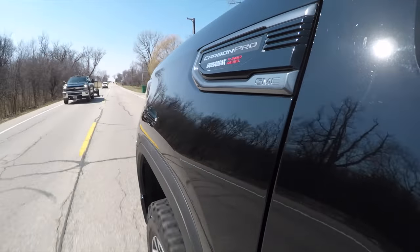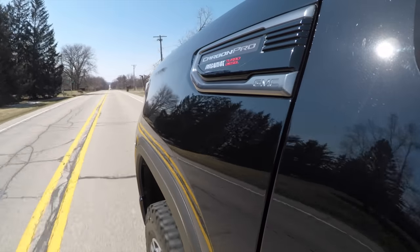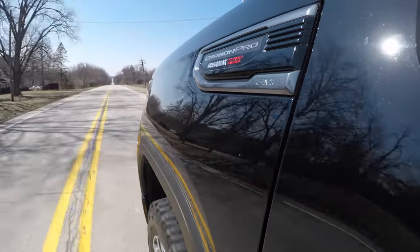This truck has a tune — it's about a 40 horsepower tune, so about 285 to 290 to the rear tires. It's a nice balance between really pushing the truck hard and having something that's long-term reliable. The factory calibration engineers allow the engine to run quite rich at full load. Typically on a diesel you'll see a 16 to 1 air fuel ratio as kind of the minimum, maybe 15.5. On this truck you'll see close to 14.5 — so 1.0 lambda, even 0.95 lambda in some cases. That means you're getting a lot of fuel per air, stoichiometrically fairly rich.